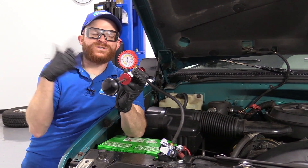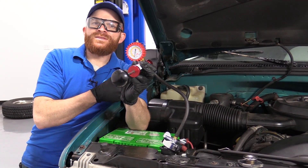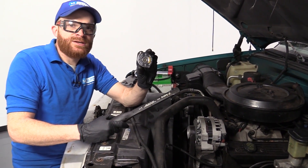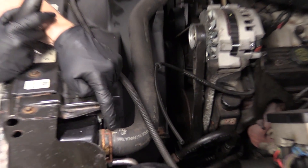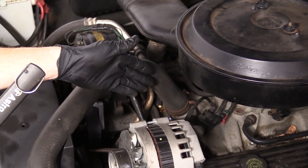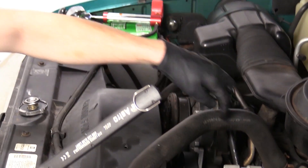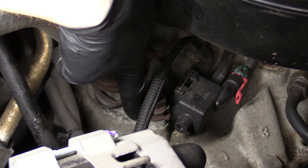Put on your safety glasses and hand protection, get underneath with a flashlight, and try to find where it's coming from. The radiator cap is the simplest solution. Also check the upper radiator hose where it connects to the radiator and follow it to the thermostat housing. Check the lower radiator hose going from the water pump to the radiator. Another leak area is where the thermostat housing connects onto the engine — the gasket can go bad.